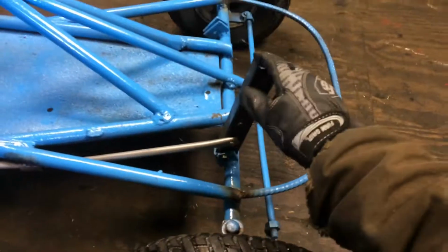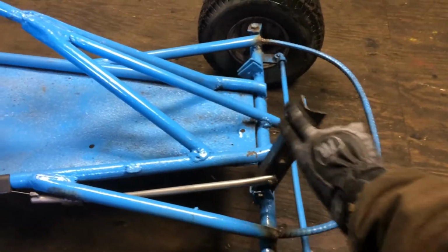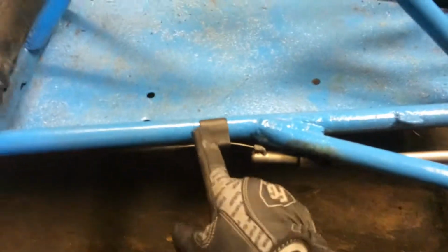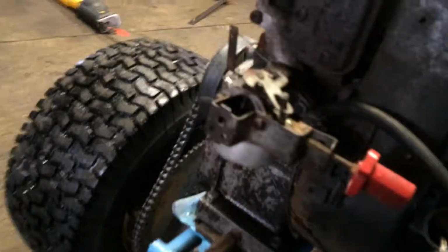All right, so I got a gas pedal. It's quick, it's dirty, but it works. So we got my little angle iron here. It returns pretty nice. Go into this little bar that runs through a little sleeve, hook to a lawnmower thing, drill the hole in that, put it there, cable runs under the seat. Got her connected right here with that, and then I got to set it up better. Right now it's kind of rubbing on here, and then she's wired up.